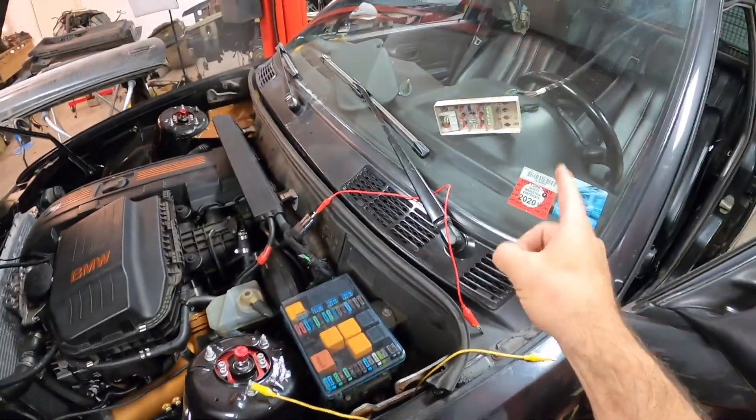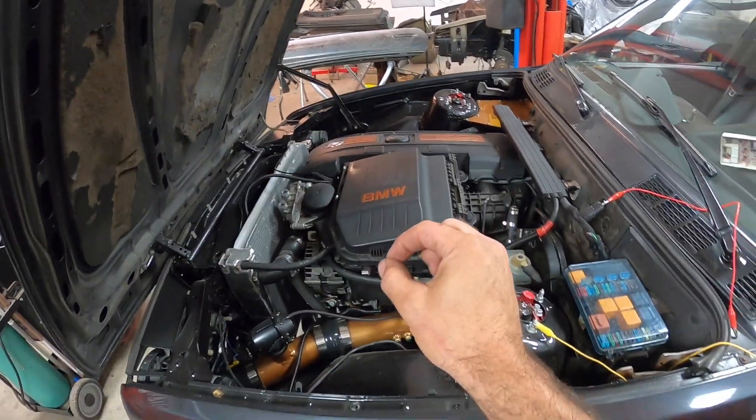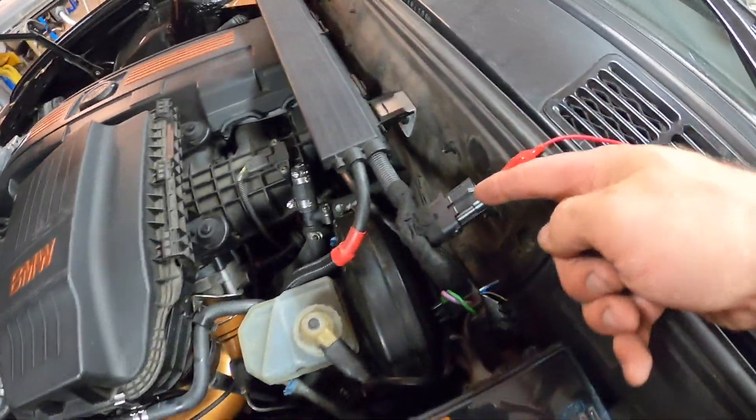For sake of argument, assume that the wire I have wired up from the radiator goes straight to the coolant indicator on the instrument cluster as BMW designed it for the E30. Having said that, let's try to manipulate the resistance values on the cluster to get the exact resistance values that we need to see for each of those hash marks on the actual gauge. Here is the wire that is coming from the gauge — it goes into the C101.